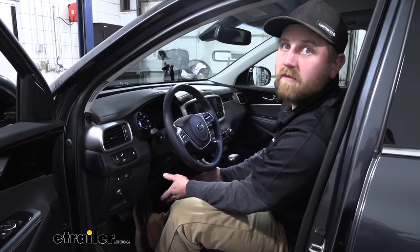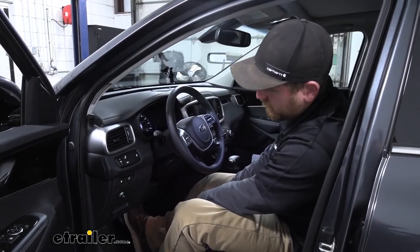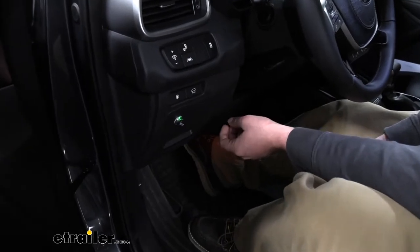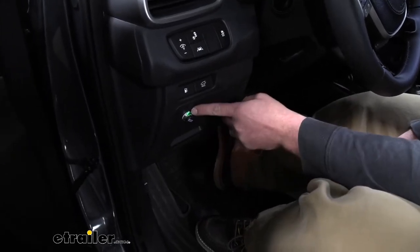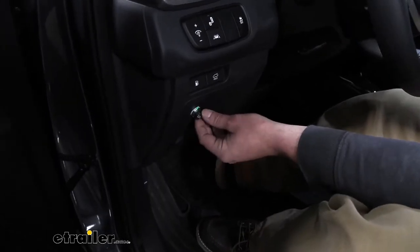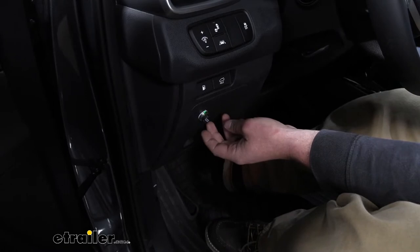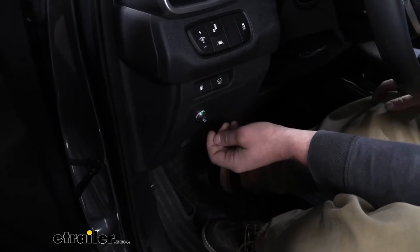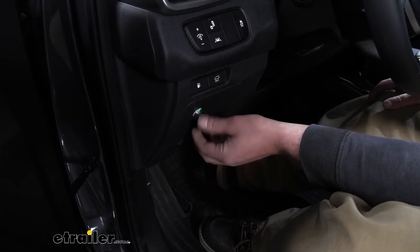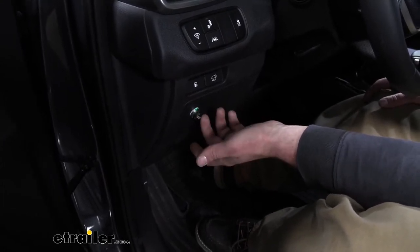This also has a user control mode. To get to it, push down on your brake pedal, push the knob down twice quickly, then let off the brake — you'll see a solid green light. You'd use this when going off-roading, pulling a small camper, or when road conditions aren't ideal. It will apply your trailer brakes to the level you've set them at, so it's always a good option to have.